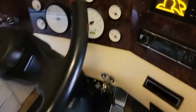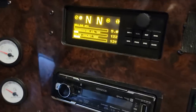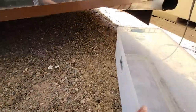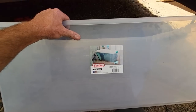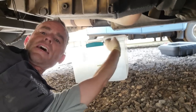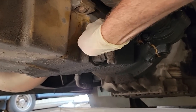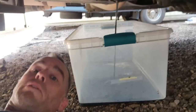So obviously we need to start it, run the engine, get it up to temperature. We let it run for about 10-15 minutes. Instead of using a small drip pan and stopping the oil flow 15 times, I just have a great big huge tote — 106 quarts or 100 liters. That should fit. So we'll go ahead and open up some ventilation to the crankcase. I lucked out because the previous owner went ahead and put a drain spigot on for me — I just have to lift it up and turn it. So just go ahead and let this thing drain. We'll deal with the oil later.